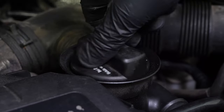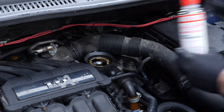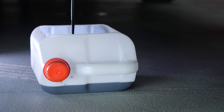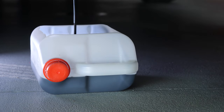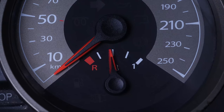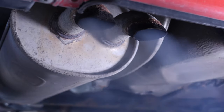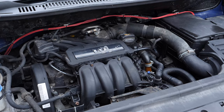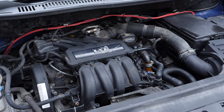Before draining the oil, we recommend adding a pre-oil change cleaner to the used oil. This will enable you to unclog your engine and get rid of any persistent residue, to reduce your consumption of oil and fuel, and to reduce the polluting emissions as part of a technical checkup. Before using it, start your vehicle for 5 minutes so that the oil is slightly warm.